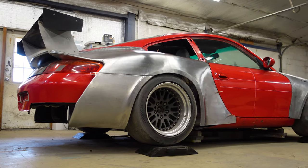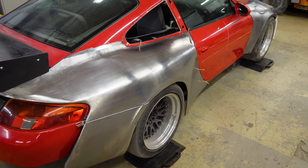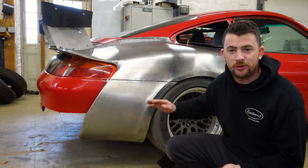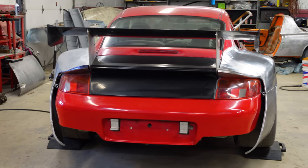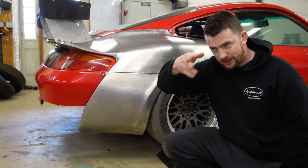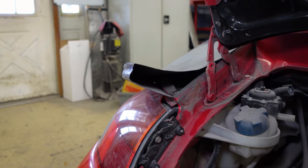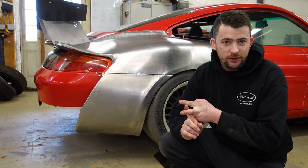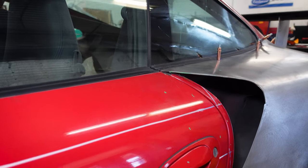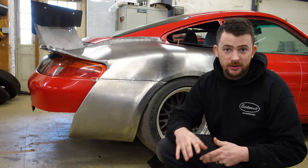We got our bumper extension done. There's some planishing that needs to be done in the end, but we'll get there. Both bumper extensions are now done and I made sure they're symmetrical. We also cut the backside of the bumper down so it's fully level all the way across the bottom — there was a real step there and we cleaned all that out. What's next: we have the edge of the quarter panel at the wing to cap off, the taillight openings to sort out, and the quarter panel intake openings need to be symmetrical so we can make the ductwork. Once that's done on the back end, I think we'll be about ready to weld the quarter panels on.